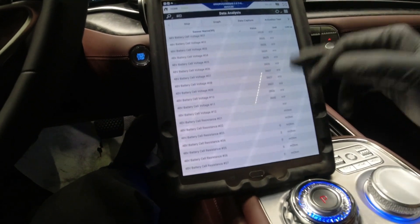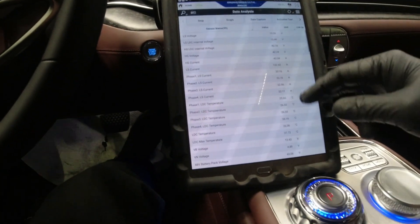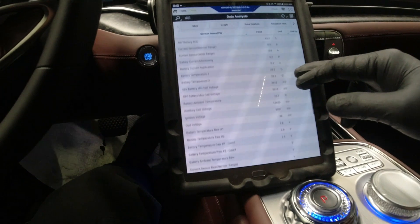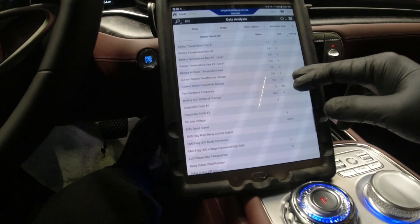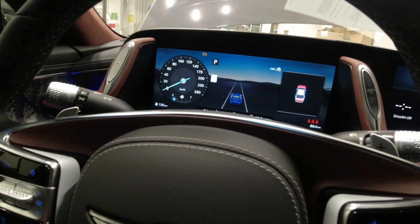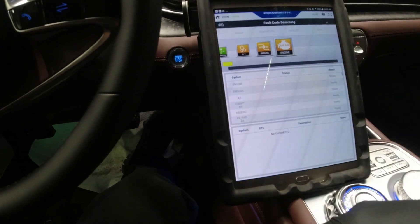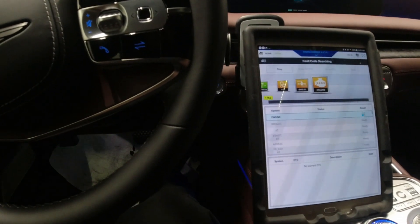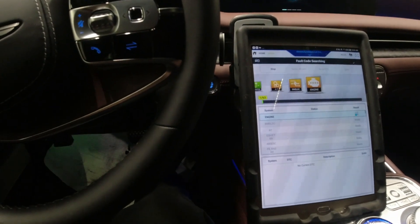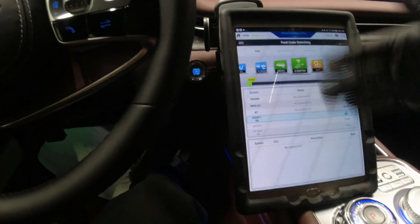Last time, the charging voltage was showing nothing — I was just reading the battery voltage from the small 12 volt battery. I'm going to do a full system scan. What I think happened is: we had a failure on the 48 volt system while driving, it was consuming all of the 12 volt capacity, which eventually caused a no-start condition. Let's go through the full system scan and see the results.